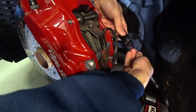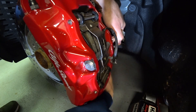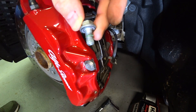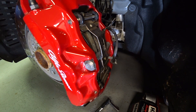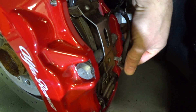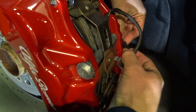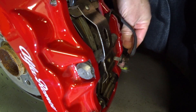First order of business is to remove the 13 millimeter bolt to get the caliper bridge removed. I'm using a 3/8 drive ratchet and a 13 millimeter socket. When you put this back in, make sure you don't over-torque it because you can snap the bolt — I have seen guys do that. There's a little cable tie here for the brake pad sensor — we're going to remove that cable tie. There's also a little bracket you can remove, but I'm going to leave it on for now. We'll just unplug it right here, and this is the end we're going to cap off in a couple of minutes.